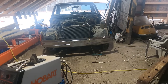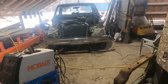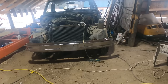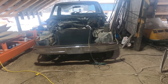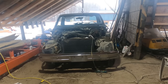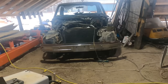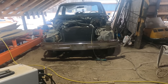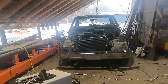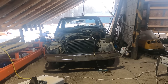I oiled the bolts for the front bumper — they're all oiled up, the rear bolts are oiled too. I'll let them sit and when I'm ready I'll unbolt them. I'm hoping we can save those chrome carriage bolts. Then we'll pop the back bumper off as well. Once the cab's off we'll clean the frame up, give it a good spray job, and I may build a good trailer hitch for it later on. Then probably four new tires and four new shock absorbers. We won't have much money into the truck — it's going to be our time.